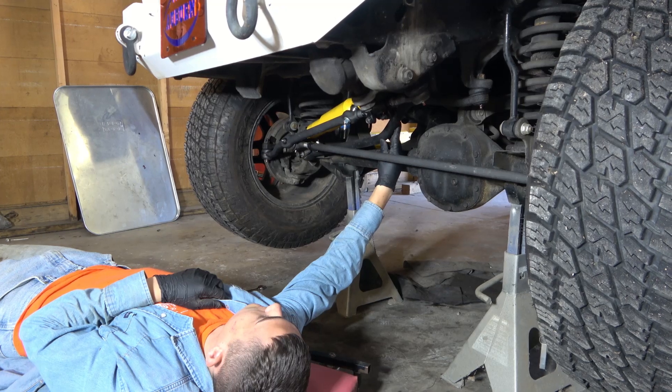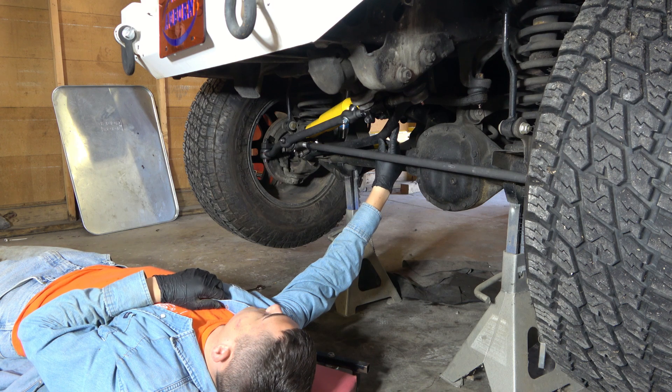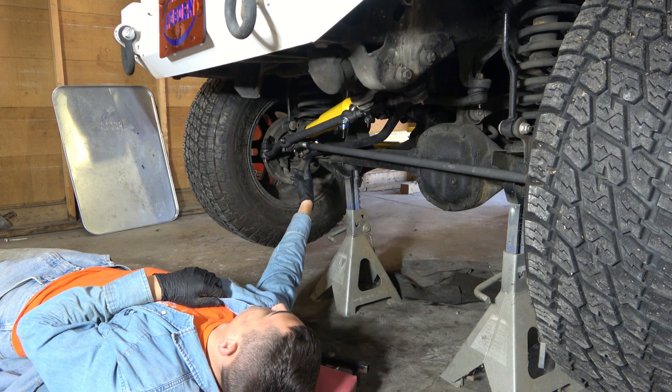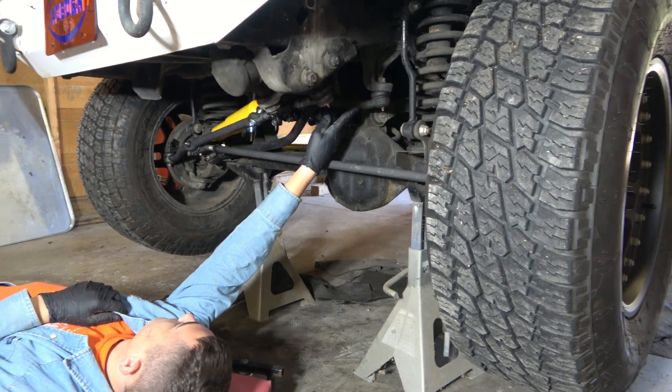James Air is holding onto the track bar — it's identical on a TJ and an XJ. That's what we're removing today. To remove the track bar, it works best to have the suspension weighted because it takes the pressure off the track bar. What the track bar is doing is locating the axle laterally, side to side. The bushing on the right side, or the passenger side, is what's worn out. The track bar has been relocated for the lift kit, so we've got to remove the nut and the bolt, and then the ball joint at the other end of the track bar has to come out.